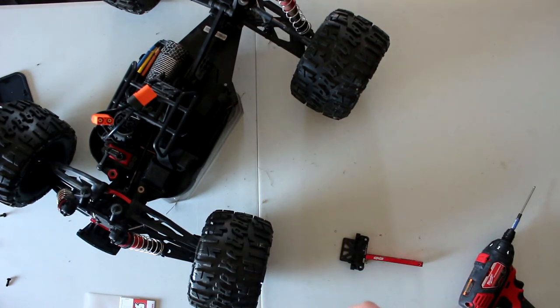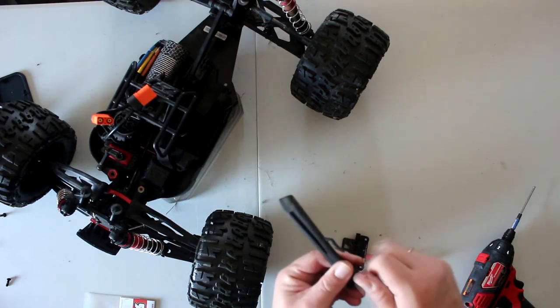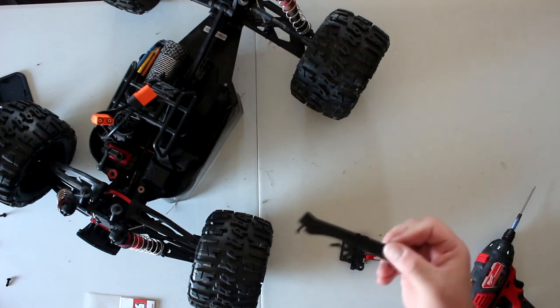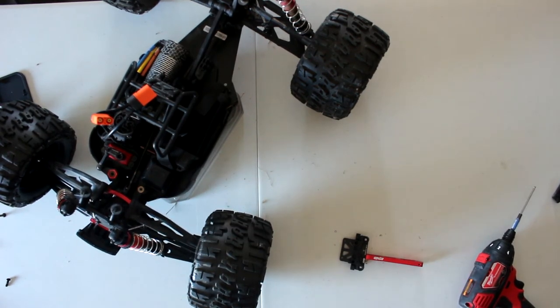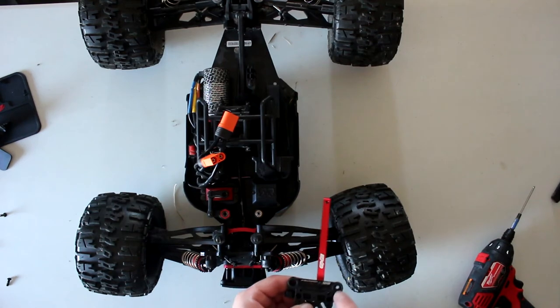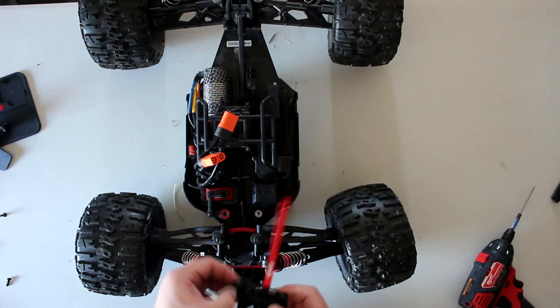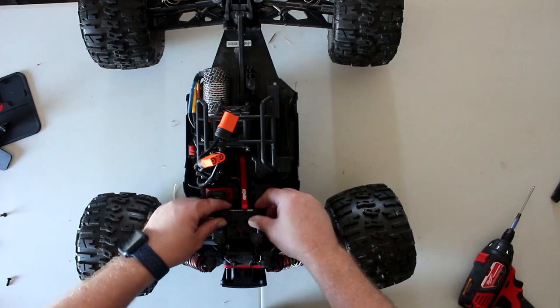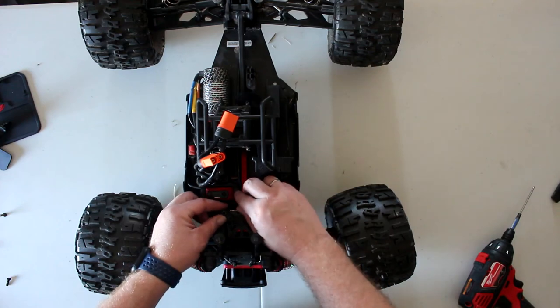What I normally do is take the screw I took out and put it back in right here, because it does have a nut. If I ever decide in the future to swap this back out — if I'm selling the vehicle or something — at least I have all the parts, or I'll leave everything with the new owner. Bring the vehicle back, and like I said, make sure we put our spacers and washers back in. Align the brace — you'll see your hole, but don't worry about that for the moment.